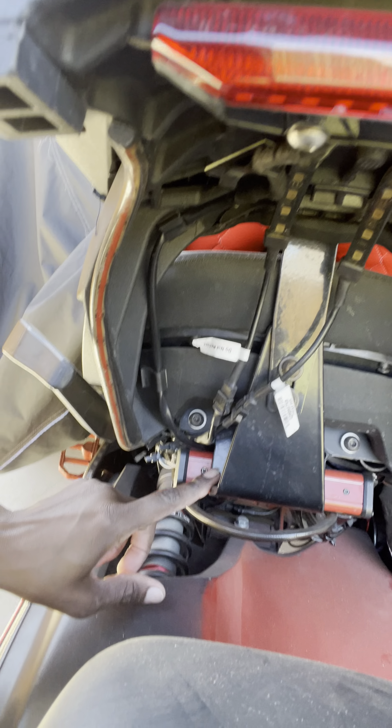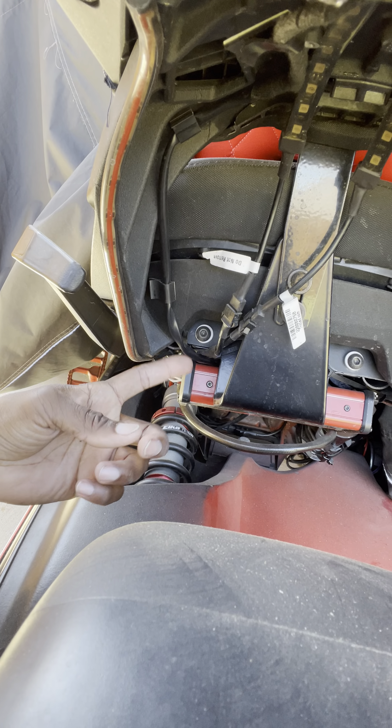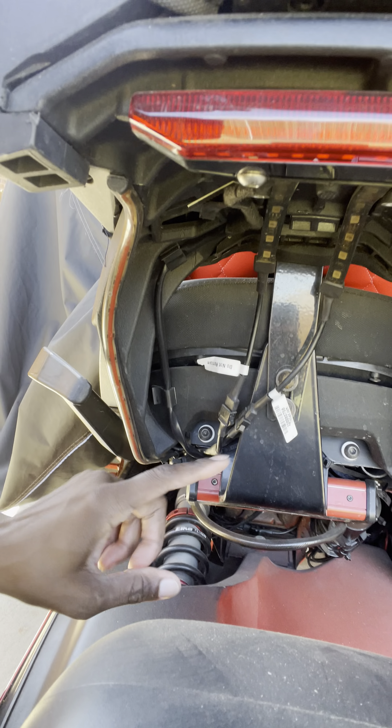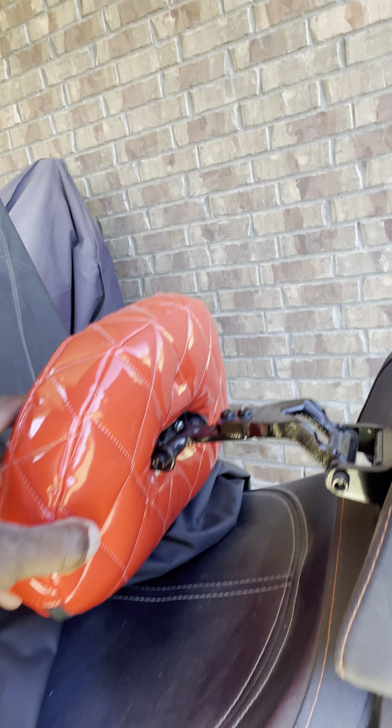So, I'm going to go to the back of the bike over here, just as a quick reference for you guys — I'm going to point some things out as we sit under here. So you see — this is that bracket. You got a spacer there. Those are the nuts that go there — your frame to the bike. The other part of that bracket — this is the two screws that go up here. So you'll see how that bracket comes through. You can make your adjustments. See how free-flowing that is? You want it free-flowing. That's exactly how you want it.